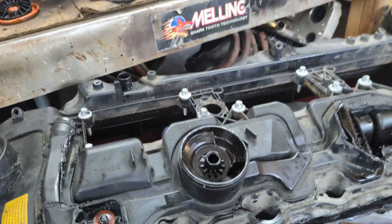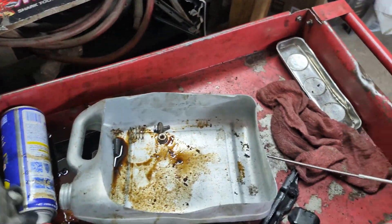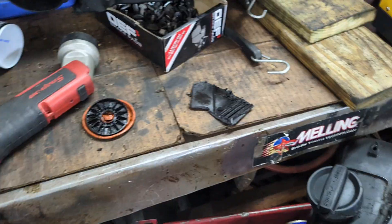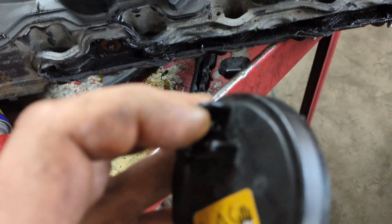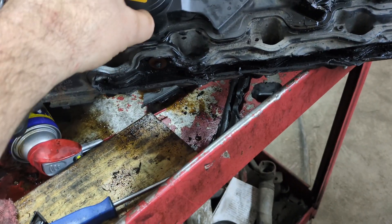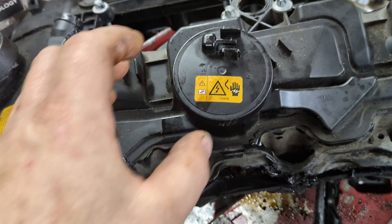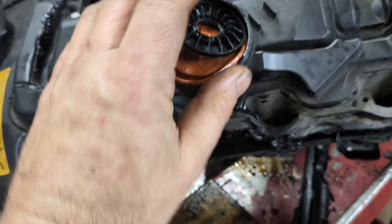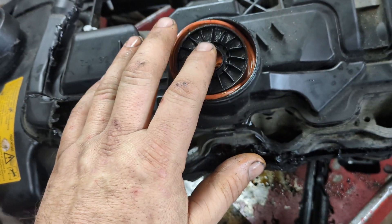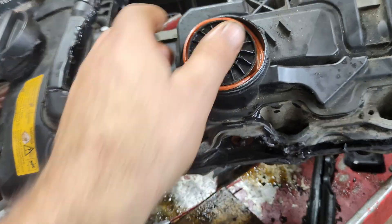A common misconception — let me find the cap — here it is. The misconception is that this cap actually lets air in and out. It doesn't. It is basically only an air inlet to regulate the chamber itself. When it's all sitting together, you have a little chamber here, and as it expands and contracts it opens and closes the valve, allowing for movement.